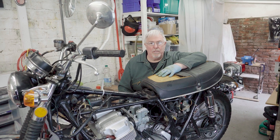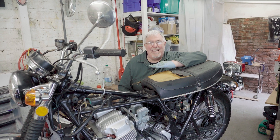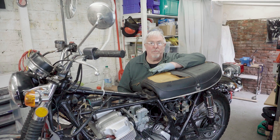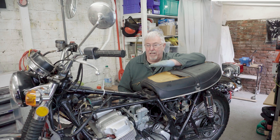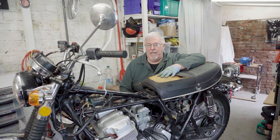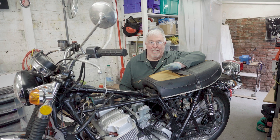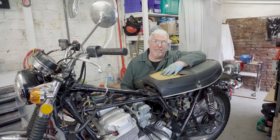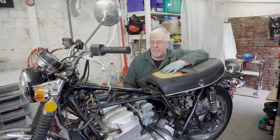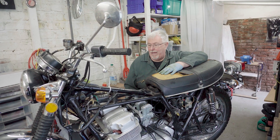If they were low, or one of them was low, you could put a little bit of oil in through the spark plug hole and run the test again. If the pressure had gone up it would imply that the piston rings were the issue rather than the valves. As they were all okay I didn't need to do that. I was going to do a leak down test to identify where leaks are coming from, but I'll be honest — I didn't expect this consistency with the cylinders. At that, I'm not going to bother with a leak down test now. It doesn't seem necessary, and I can now move on and look at the next part of the job.